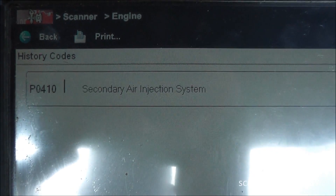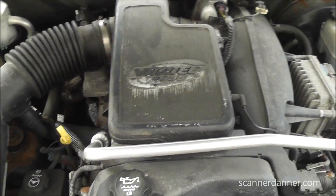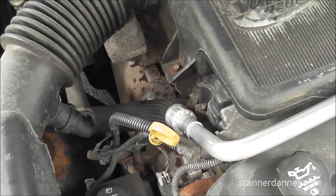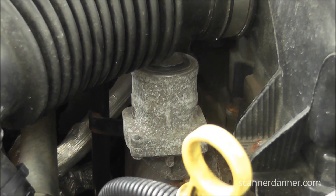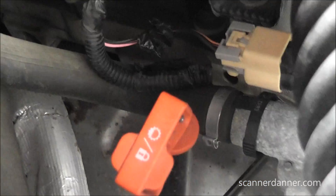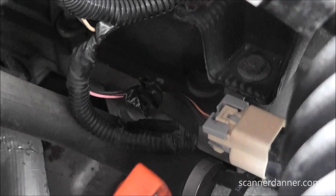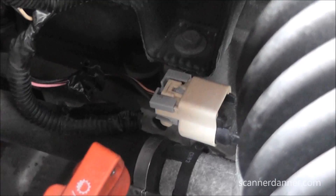The code is P0410 - you can see the description on screen. This is a 4.2 liter engine. My first thought going in was: where is the air pump? I know it's an electric air pump and I had trouble locating it. Looking at the exhaust manifold I see this canister-looking thing. At first it looked like the EGR valve, but I noticed rubber tubes going to it - we don't do that with EGR valves - so that has to be my diverter. The connector on top has two wires, so this design is completely electronic with an electric air pump and an electronic solenoid diverter valve.